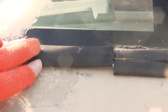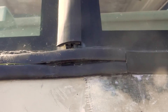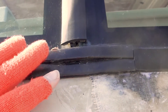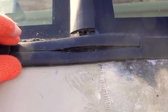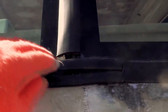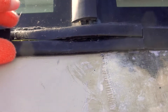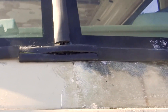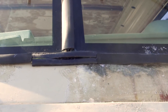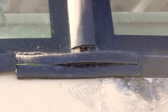This thick strip is what went all the way around here, and there was a little t-section that was just as thick that went here, but it wasn't with Winnie when I got her. So instead of finding and buying a little t-section, I just used this thinner weatherstripping. There are actually two pieces here, and those two pieces put together make a piece just as thick as the rest of it. I reused that rather than buying a new piece altogether, secured everything with construction adhesive, then caulked over it with clear caulking, and that worked out really well.